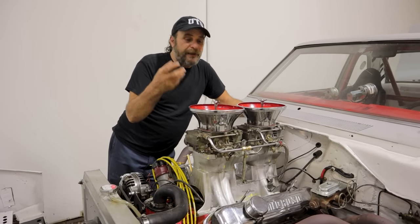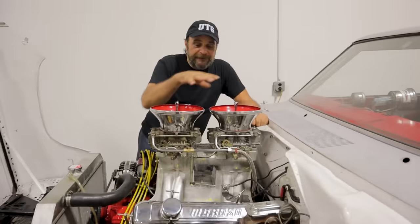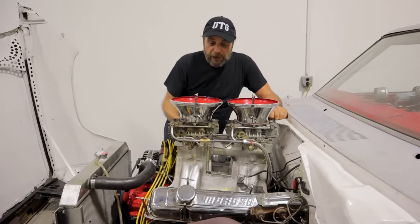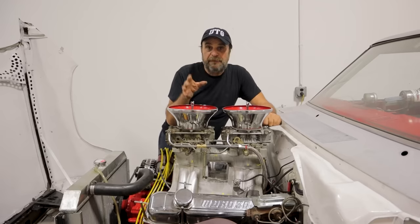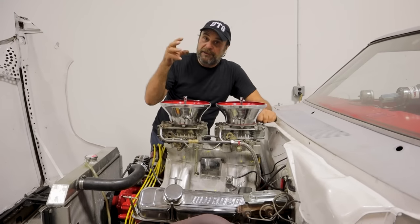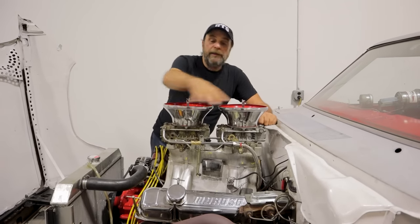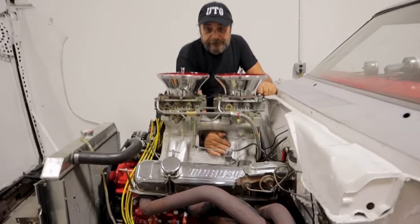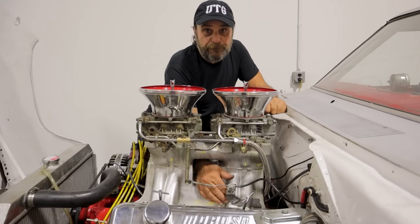Here is the ultimate thoroughbred drag racing intake manifold. The whole idea — a big part of it — is to isolate the carburetors and the upper plenum, the incoming air charge, from engine heat. As much consideration as possible is given to keeping the top of this cold. You want it cold: if the fuel is hot, it's expanded and you don't get as much through the jet. Cold air carries more oxygen. But down here, the runners are connected directly to the intake manifold, and this is where it gets hot and where vaporization takes place.